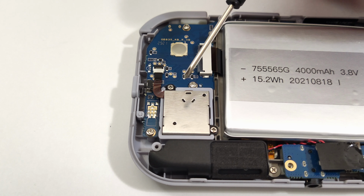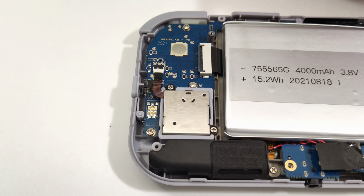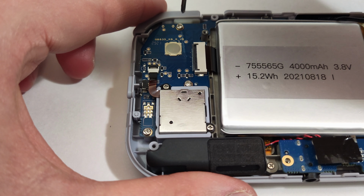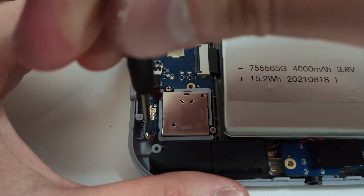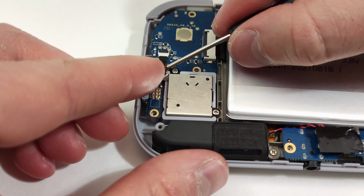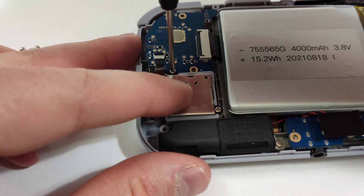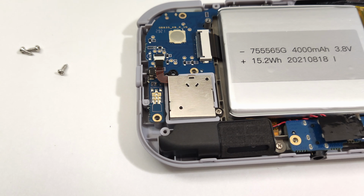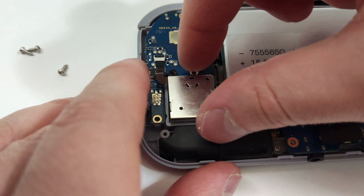There's a couple screws on this side that need to be removed first and one ribbon cable. The joystick should come out as well, so it's not in the way when we lift up the board. My left joystick is actually broken, so I can't move forward or right fully, making my characters walk in games in those directions. I've already reached out to Retroid with videos of my issues there, and they said they'll be sending me a couple new joysticks. There's a lot to remove here, just make sure you remember what screws go where.